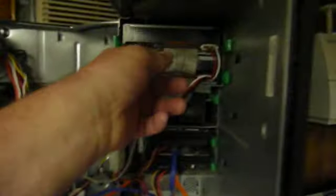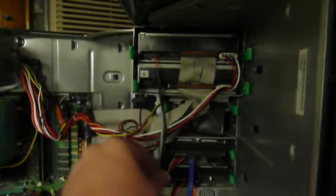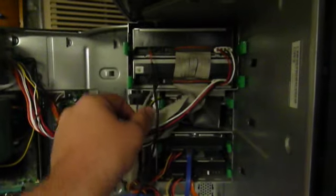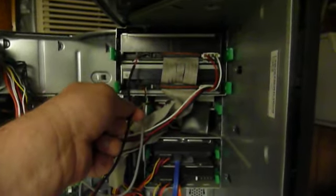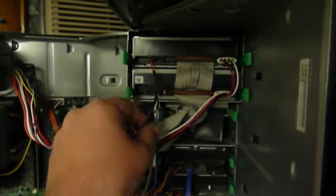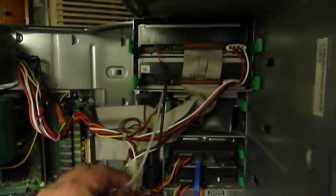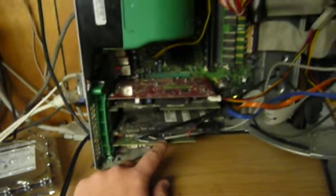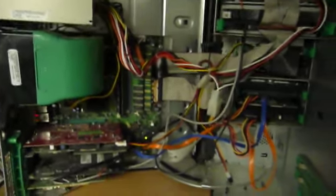Dell didn't put the audio cables in this machine leading from the CD drives to the sound card. And so we have one digital S/PDIF, Sony Philips digital interchange format, I think, it's been too long since I've looked. But one of them feeds into the Sound Blaster via digital audio output. The other one, although it has the pins, the S/PDIF interface was non-functional, and so it goes in via analog audio. Anyway, that's pretty much an overview of this Dell Dimension 8300 computer system and what I was planning to do with it.